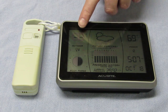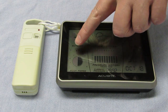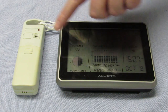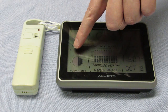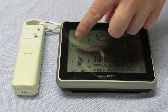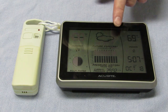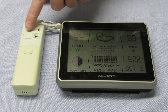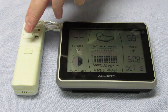Yeah, and this is a telltale sign, guys. If you see these little dashes, right there is a tiny little line that shows the wireless connection to the sensor unit that sits outside. That didn't show anything either. I didn't realize that that's a little wireless sign, but it should have the bars there if this thing works correctly. So I knew that either this unit's wireless receiver, or the sensor's wireless receiver, or something else on this device is wrong.